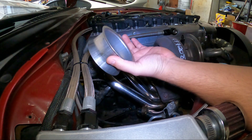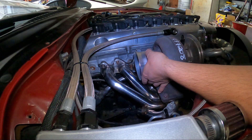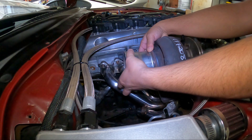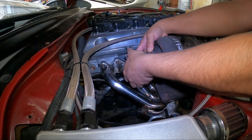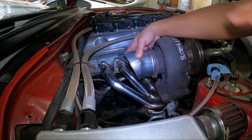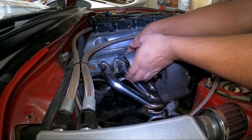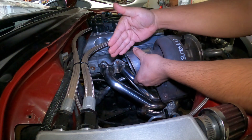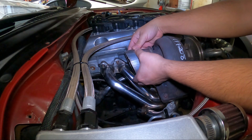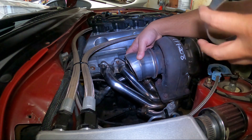As far as fabricating the downpipe — very very simple. First you want to start off with either your V-band flange or Marmon flange — in this case for the Borg Warner. Basically from here you start using pie cuts. Give yourself an idea of how you're going to route this. We want to go down but we can't go straight down since the turbo runner's right here, so we want to go down at an angle toward the passenger side. Thankfully with pie cuts you can maneuver it whichever way you need.